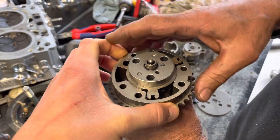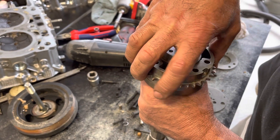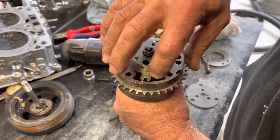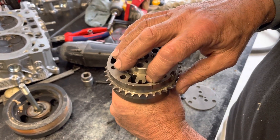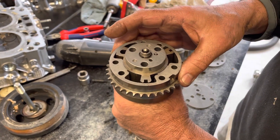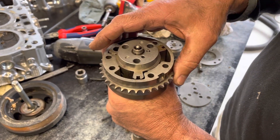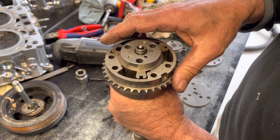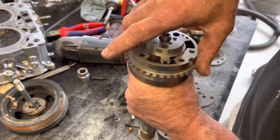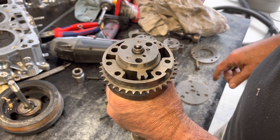So there's more pressure on one side. If you've got oil pressure on this side, and the tension of the chain is in that direction, it can't squeeze the oil out of there. So as it releases the oil out of there via this solenoid, it can actually keep turning - so the more oil it releases out of there, the further it advances. Then it pumps back up and does the same again, constantly varying it.